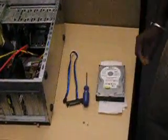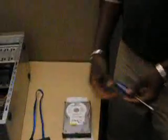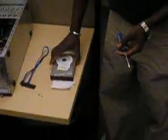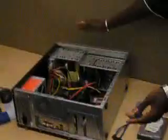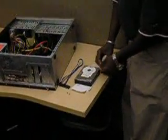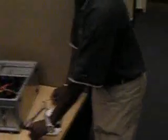Also, make sure that you have all the tools available. Here's a Phillips screwdriver, which you will need to mount your drive. You're also going to need a serial ATA cable — here's one. And of course, you'll need the drive itself. You also want to make sure that you have clear space to work with, and don't forget your mounting screws — that's very important.